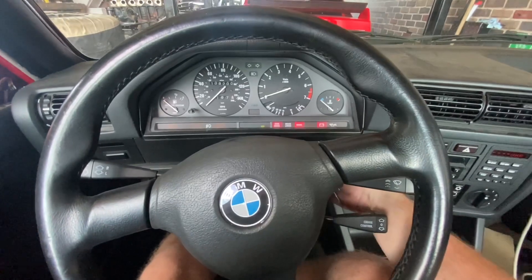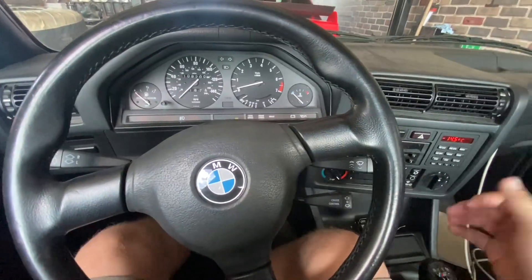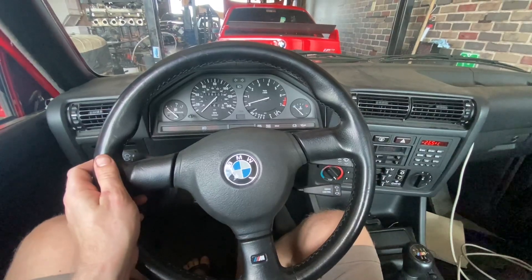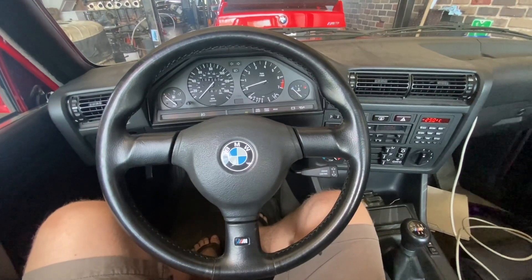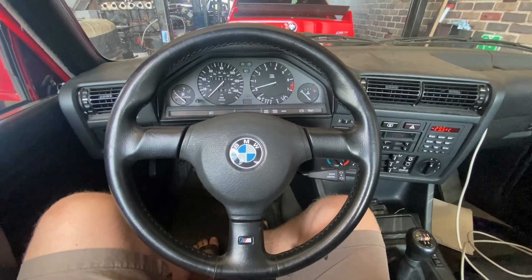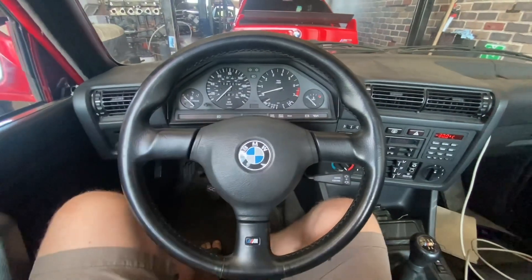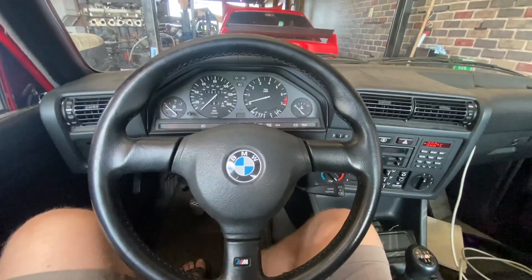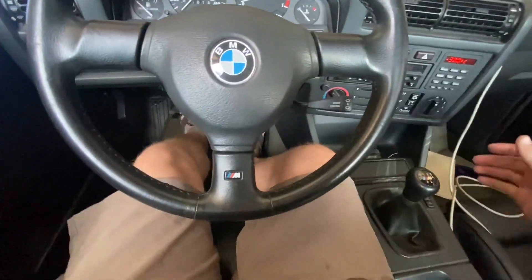It's not a six-speed. There's no idle control valve on this thing right now, so cold starting is a little iffy. With MegaSquirt, the tach never works right — I'm going to have to look into that again and see if there's a way I can correct it. Also, maybe I should go get gas. This thing is empty. Idle's already smoothing out. That's nice.